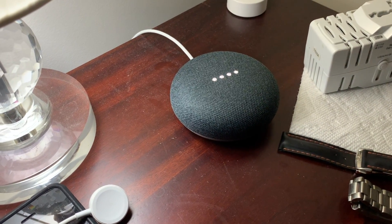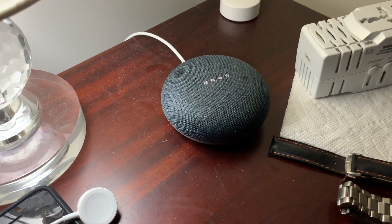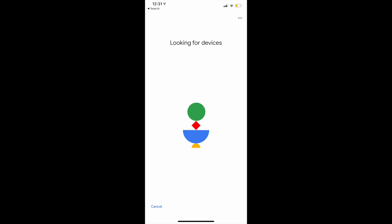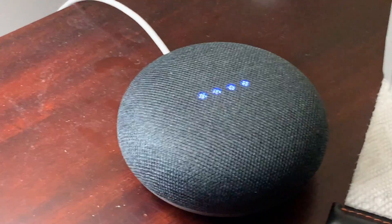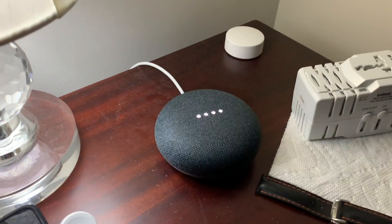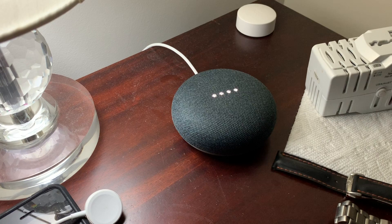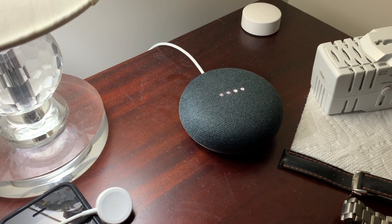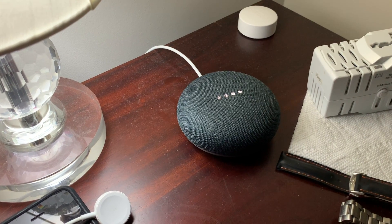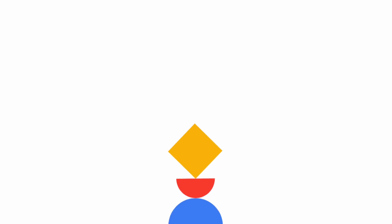There we go — it looks like I reset it properly. It says 'Welcome to Google Home. To get started, download the Google Home app on a phone or tablet.' It asked me to connect my app and I connected it. At this point you should have four blue lights once you connect in your app. The other thing I forgot to tell you is that you need to unlink the old one that was in your network before, then add a new device. It'll ask if you saw the blue colors, and then you link it to your Wi-Fi and put in your password.